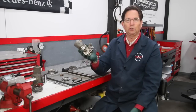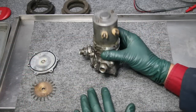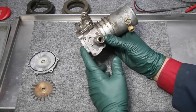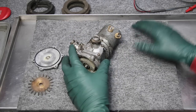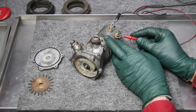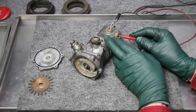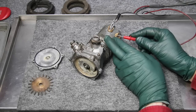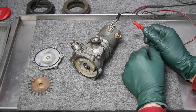Let's get up close here and I'll show you what was going on. We'll give this a 12-volt test so you can see how the motor's running, and then we'll talk about how we're going to fix it. When the pump was mounted in the car, I applied 12-volt power to these two contact points and the pump wasn't running. So I removed the pump from the car and removed the bottom plate and the impeller. Now watch as I apply power — I've got my booster here. Look at that, I think you can hear it running. It has a nice sound, the bearings sound okay, and it starts up and runs very smoothly. Notice the motor doesn't have very much torque — it's a brushed motor and that's part of the problem.